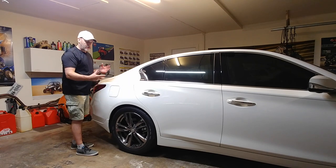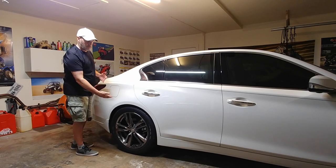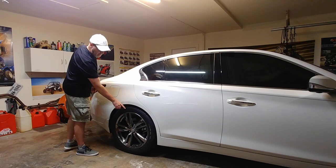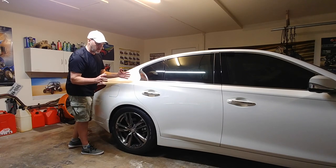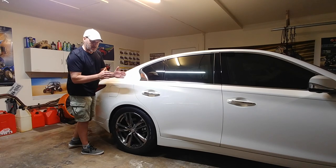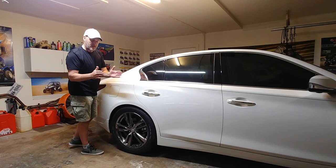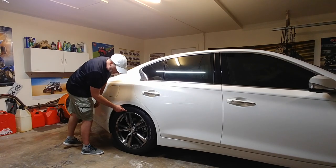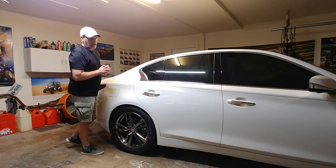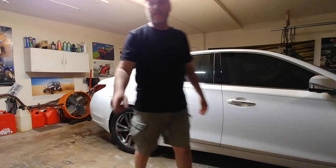In this video I'm going to experiment and bring you along to see if I can get the wheel to rise up and fit under there without damaging anything. Obviously this is an 8.5-inch rim so there's a little more overlap on the tire. When I go to a 10-inch wheel, the tire won't have that bulge — but then the rim is coming out, so it'll ride a little flatter. I'd say the bulge difference is less than a quarter inch, so it's not by much.